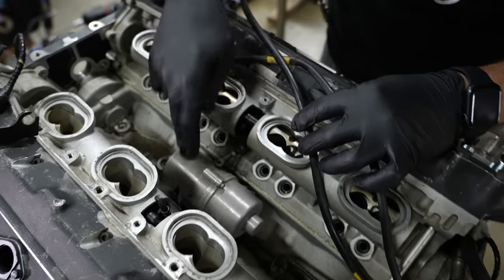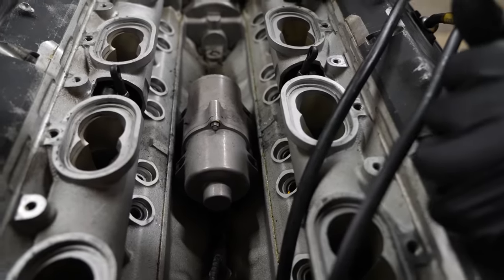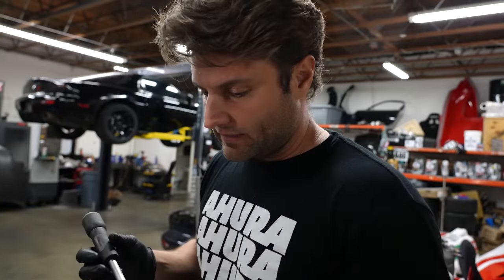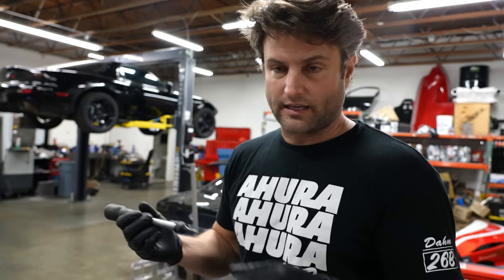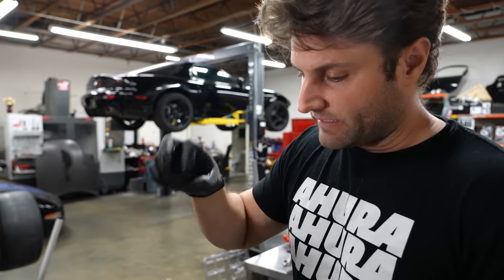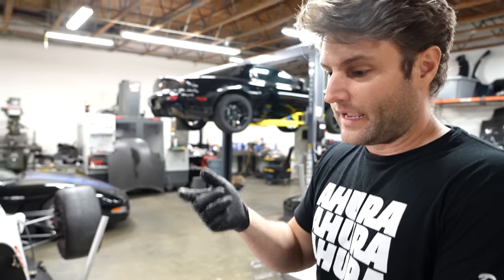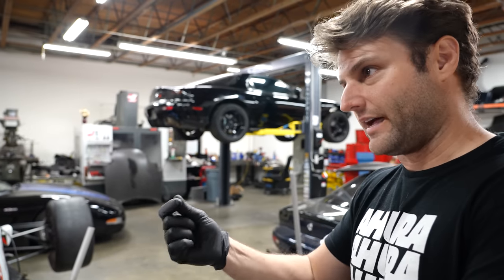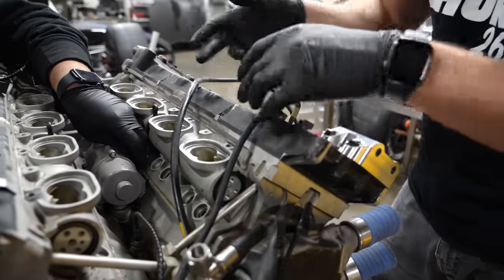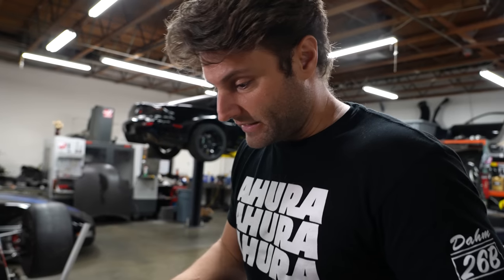With all of that off, it's got me wondering — do you guys know what this thing is? It's connected to the crank case. It's four bolts. A real cool rule of thumb: a lot of the mechanical fastening on engines of this type are actually not Loctite — they're mechanical lock. On modern engines, they'll use the mechanical lock first, and then when they put it back on, they'll use Loctite. And if they see a bolt they take off that has Loctite, they throw it out. So it's got two lives and that's it. Everything on here is the minimum number of bolts needed — that's essentially how you figure out the strength of something based on the fasteners they use.